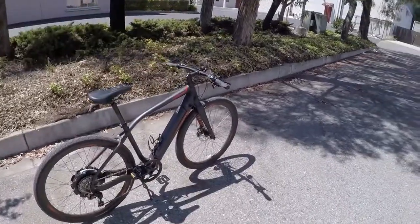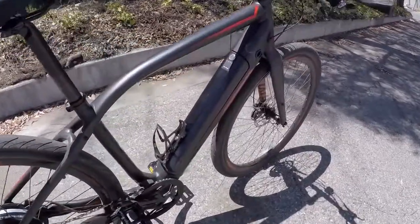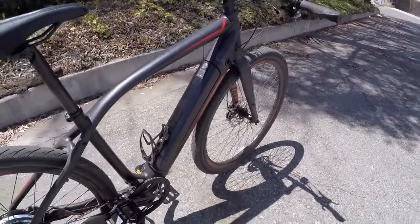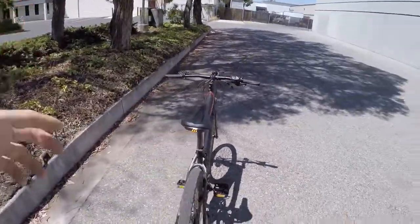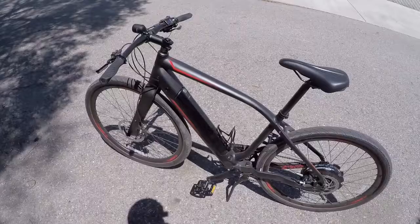And then you get up to this, and you're really stepping it up for the performance and the extremely large battery. This is like a 36 volt 19.5 amp hour battery pack, so big, definitely going to get increased range with that, and it's going to help you to hit and maintain those higher top speeds, because of course your efficiency drops. The faster you're going, the drag coefficient, everything, you're basically burning through that pack faster, and all the accelerating and stopping.